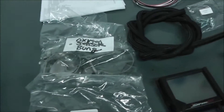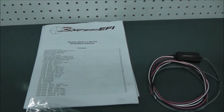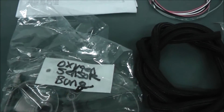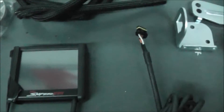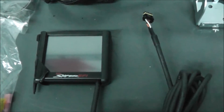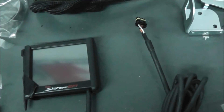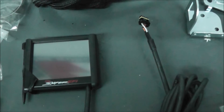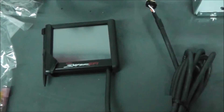If you go over here on the bench, you can see what the kit includes. It comes with the full set of instructions, your oxygen sensor and the bung, your unions, and the wizard itself. You're going to plug in just a few parameters like your air-fuel ratio, the idle setting, the cam profile, etc. Once you do that and get the engine up and running, it's really going to self-tune itself.